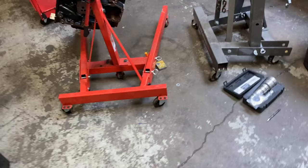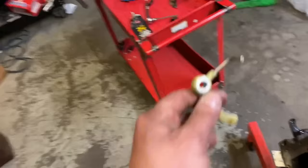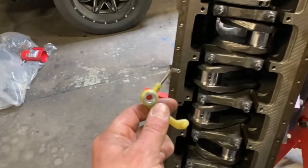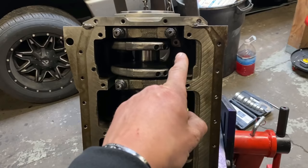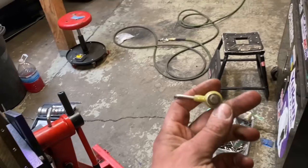All right, so lastly, before we put the rods in, J-jets. If you have an 04 and a half to 07, some of the early 04s, and I've even seen 03s use it. Basically, you see there, we have one hole that's tapped, one hole that's plugged. Pretty easy. This goes in this direction. This tab here aligns with that indent there, and you take your M8 banjo bolt, and basically what this apparatus looks like is like this. You want the jet to squirt under the piston.